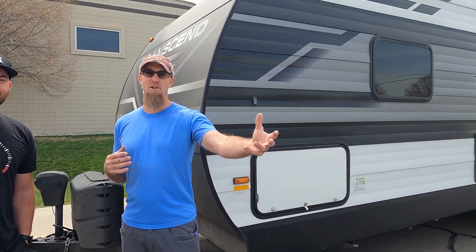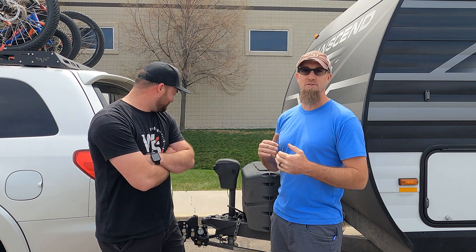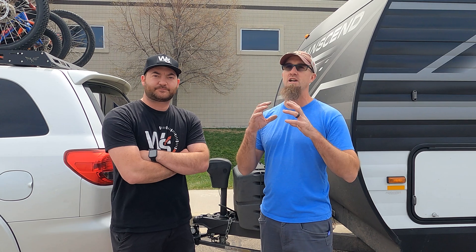As you know, we always come to the companies whose products we use. We know you guys have been having a lot of questions, a lot of concerns, and a lot of misunderstanding with the distributed weight part of it. So we're here with Morgan, and Braxton's behind the camera — he might jump in — but we're going to have that question answered from the engineer himself. We're going to talk about tongue weight and distributed weight, and why our tongue weight is 750. The question everybody has is: why is my distributed weight sitting at 1750 when I'm only supposed to have 750 pounds of tongue weight?